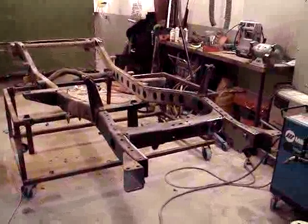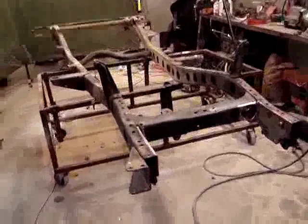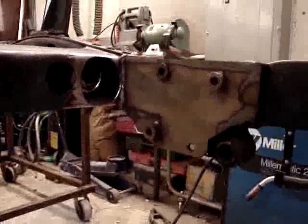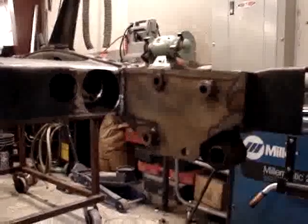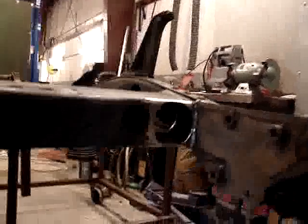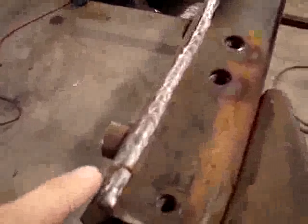The frame is pretty much ready to go outside and be blasted. The power steering conversion is complete — you can see the bracket for the box has been welded on, and the hole has been cut: a three-inch hole with a two-inch behind that. We did a temporary fit, actually bringing the box in to make sure things lined up properly. Nice stitch weld here, hard to see.